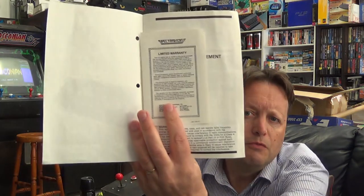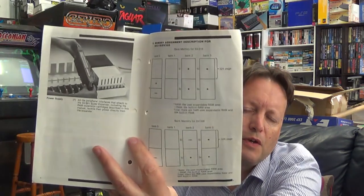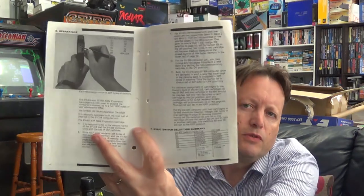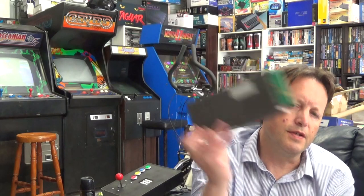It's got its little limited warranty thing in there as well. It always came with very good instructions, with photos and diagrams, telling you about how to access the memory. The 64K one came with little switches so you can select which bank it goes into. The 16K one, you don't have a choice. They actually show dip switches. So this is one of the ones that is hardwired.